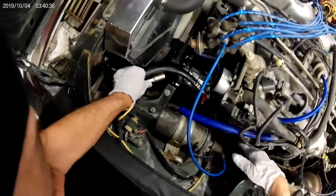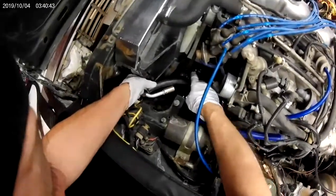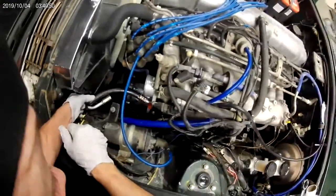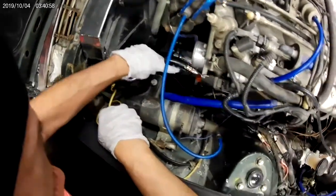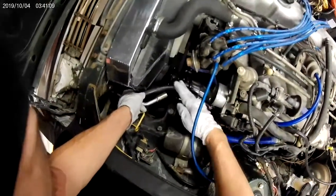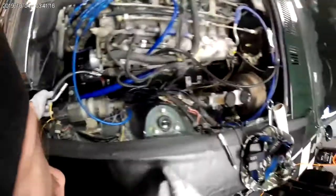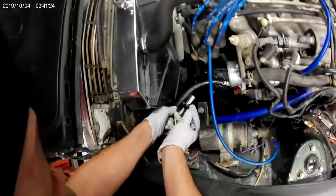The diagram shows to have these angled towards the driver's side fender. I'm trying to route the high pressure side from the compressor to the condenser, and I'm adding a bend in the hose — you don't want to make it straight. If you make it straight and have to adjust your compressor, you may not be able to go far enough. I'm adding a 45-degree angle here, and the discharge port on the compressor is angled a bit that way. I've already marked it with a pen — I'm going to cut right here and put these together.